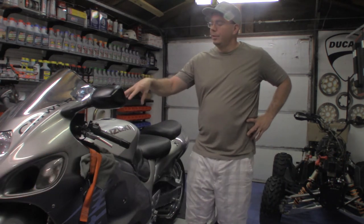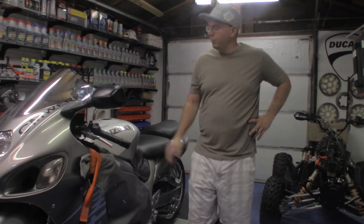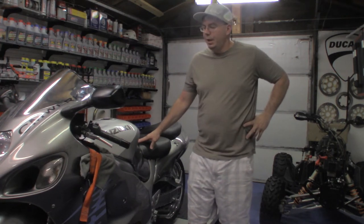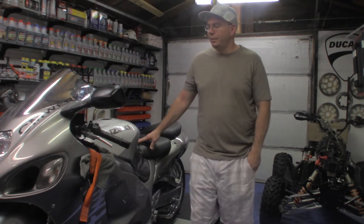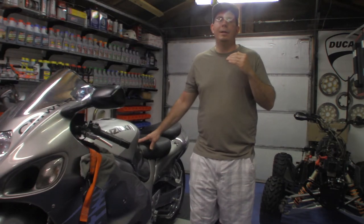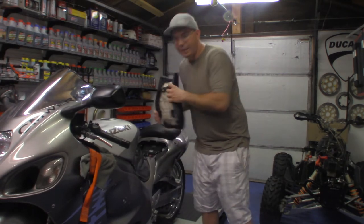This is a pretty simple process. We're going to take the seat off, lift the tank, pull the air filter out — there should be five or six screws — put the new air filter in, and we're done. This bike, I think I'm going to change the suspension next video. I did ride this bike and it seems really stiff, so we're going to set it back to factory settings. There'll be a playlist in the description below so you can go through and see everything that's being done to this bike. It'll take you right to my playlist page on my YouTube channel, so let's get started.